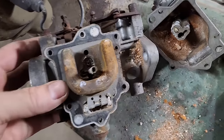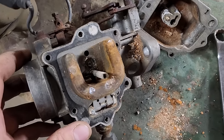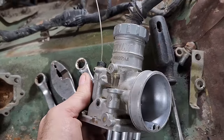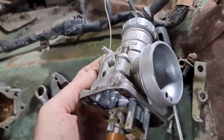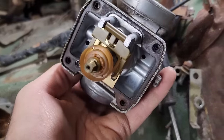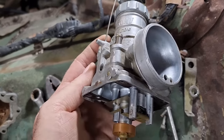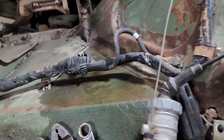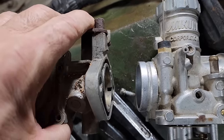Seems like the engine might be kind of sound. Well, that's kind of nasty, but honestly, I have seen worse, and I expected that to be worse. But I just remembered I had this Mikuni. I don't know what application this is off of. I bought this at a swap meet several years ago and had it on a Suzuki LJ20. It still looks pretty clean, but this choke plunger is stuck. If I can get that freed up, I might just make an adapter flange there.